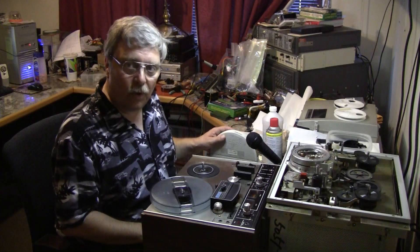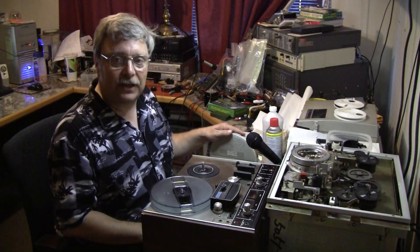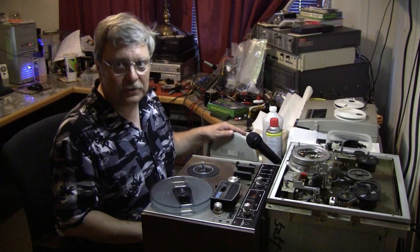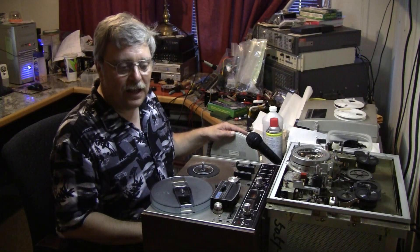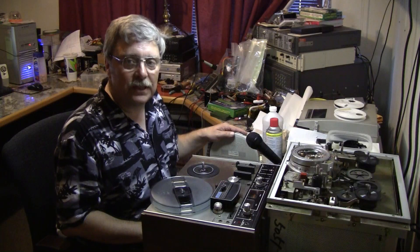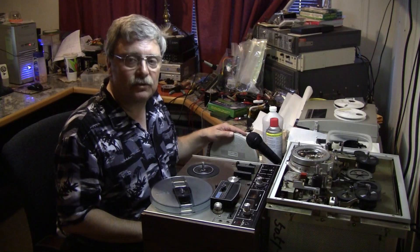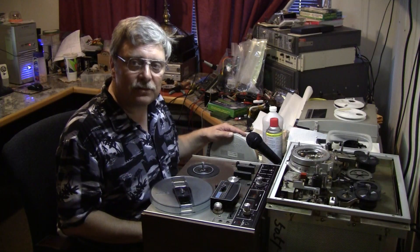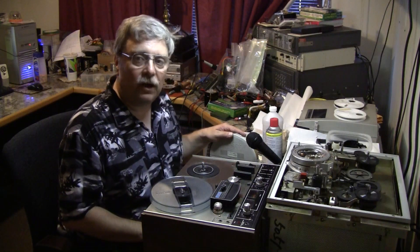It plays well, but there is no vertical sync pulse. Looking at any pulse cross on the monitor, the monitor is doing its best to lock, but the video is really good. Audio is still intermittent on my machine, which I have traced to a dirty switch and probably bad capacitors in the audio circuit, so I'm not going to worry about the audio for now.